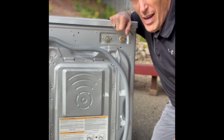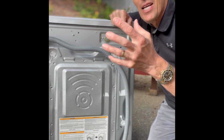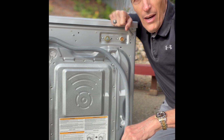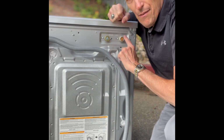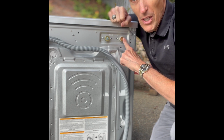And then you can try it. You can hook the hoses back up, make sure you turn the faucets back on, and see if it's better. If it's not better, it just means the valve is worn out. It's no big deal. They're really easy to change. They're very inexpensive. We'll put a link in the description below for the cold and the hot valve. We're going to show you today how to do the hot valve. It's probably a little bit easier.